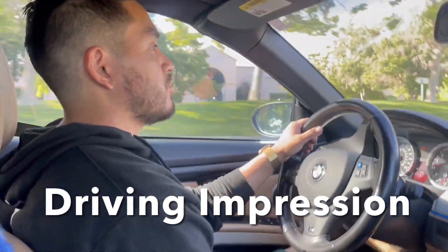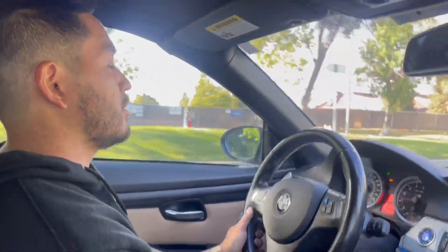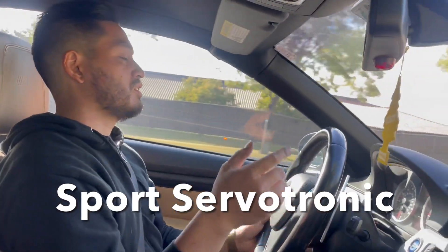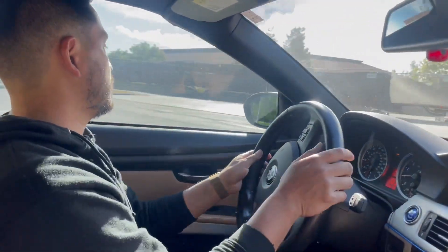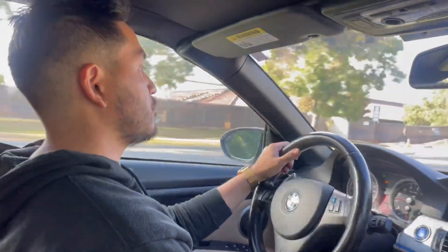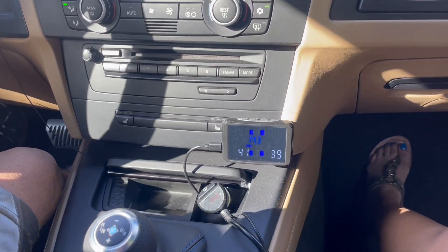While we're driving to warm up the car, let's see if there's any differences. I have the car tuned with heavier steering, so the underdrive is supposedly supposed to make the steering really heavy — we'll find out when we make a U-turn because we have the new pulley. It feels a little bit heavier but it's not too bad, not super noticeable. Our alternator is also working — we're at 14.2 to 14.3 volts, so the alternator is charging correctly.